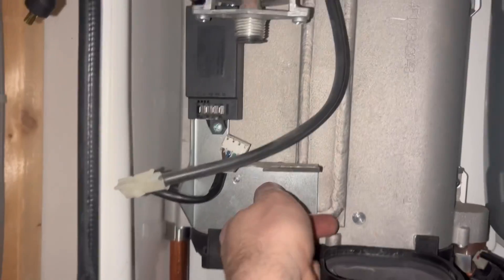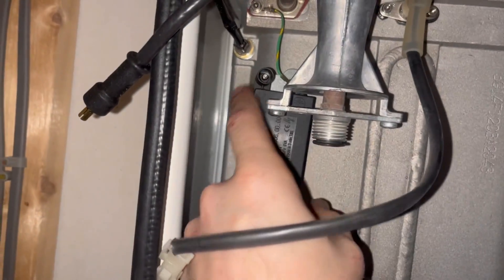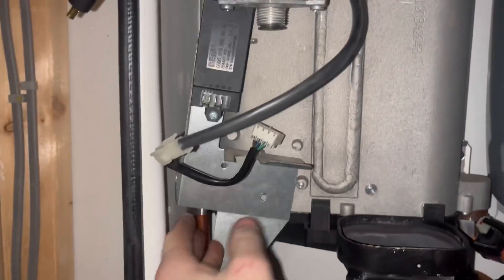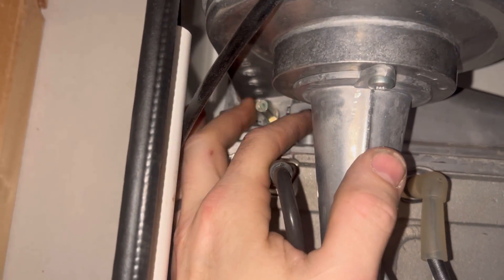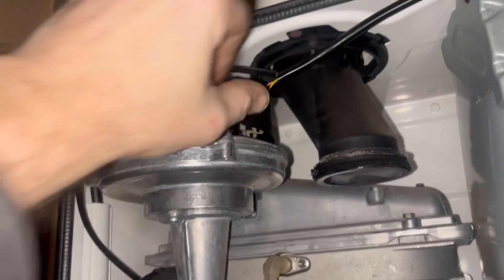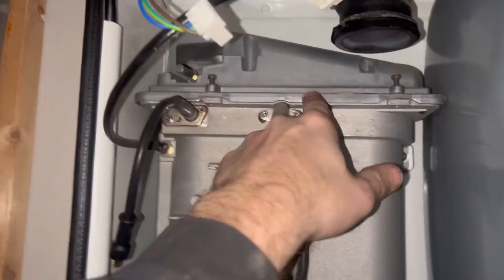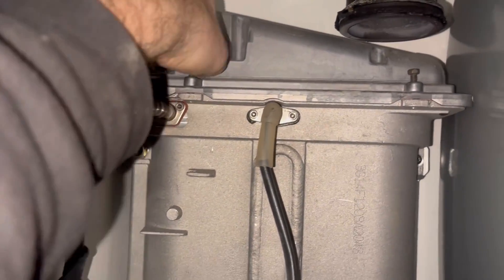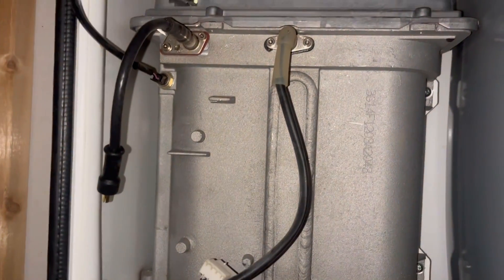While we get the plate out of the way I'll give the remaining area in the sump a look. It's two screws — one there, one there. Get that out. Electrical connection there, spark generation connection there. That's the fan out. To get the main burner out there's a screw at the front and another one to the right. Get them out — there are two bolts at the back. An 8mm spanner is really good for getting them out.